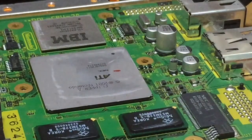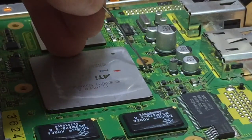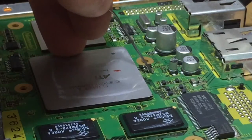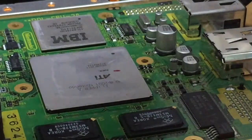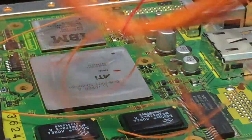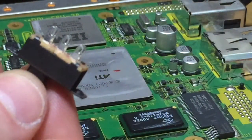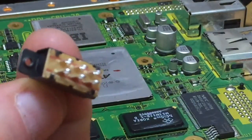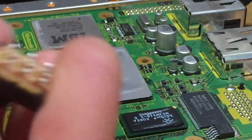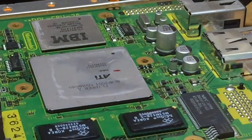It's called the R6 anyway. R6 chip, the rear terminal, looking at it from this viewpoint, it's basically there. That rear terminal, it says R6 here. From where it says R6, you need to put a little bit of cable from there to a couple of positions on this switch. One of the middle ones and one of the end ones. Either middle one, but then one of the corresponding end ones. So if you choose that middle one, you need to put it on that end one or that end one, so in the row, so it switches.